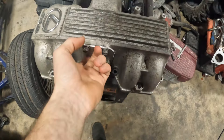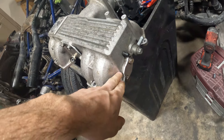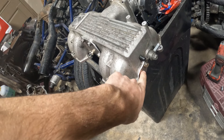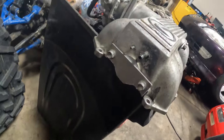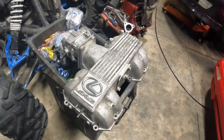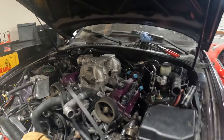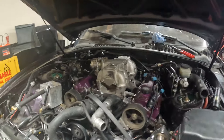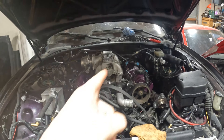The EGR is blocked off — back EGR part too, it's been so long since I worked on these motors I can't even remember what that goes to, but it's EGR related — so blocked off, blocked off, and then IAC is blocked off as well. Really cleans up the intake. Let me get her on the car — yeah, definitely looks a lot cleaner with all the junk gone.